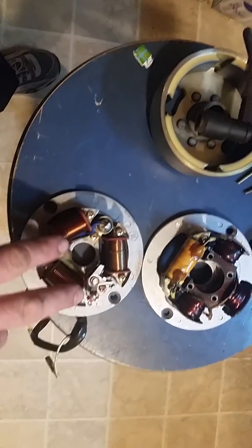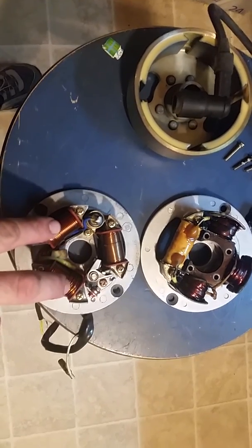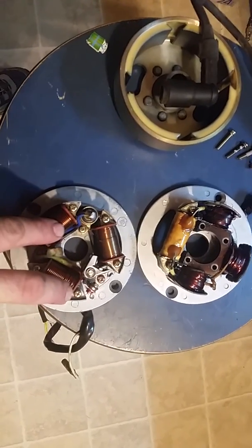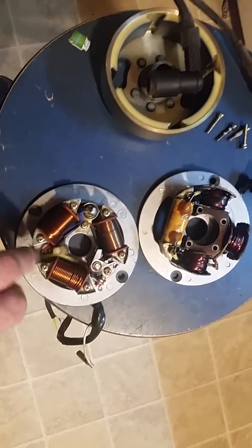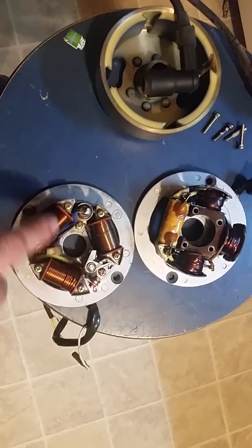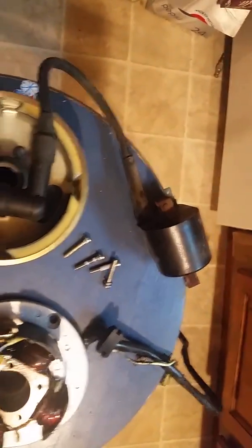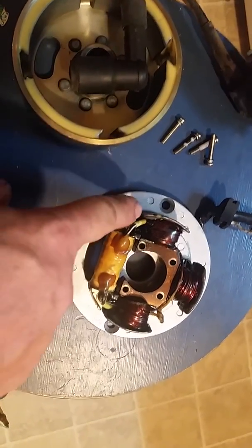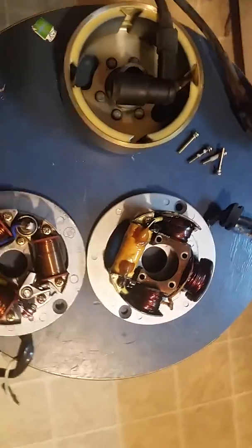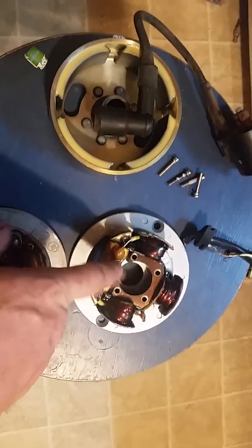In my previous 6-volt to 12-volt conversion video, I had removed these two charging coils right here. Together they go through the regulator and come out with 6 volts. I then put in a longer coil that went across the actual length of the stator — that's your CDI coil, what powers your electronic ignition. It has the same bolt pattern, same thickness, same everything — just different windings. You cannot charge your lights with this coil; it is solely for the electronic ignition.